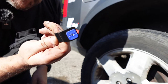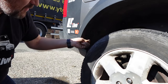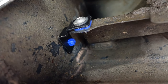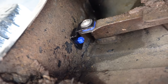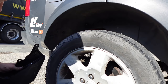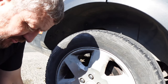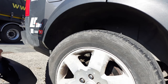You have to put a retainer into the bracket and another one into the square underneath. I'm going to use all the original screws — the one from inside the wheel arch is the best one to fix it into position. The bracket is fixed with an original screw into the speed clip, goes round and faces forward toward the wheel arch trim. That's really the only hard part of the installation. Once that's done you've got three fixing points — the additional one at the bottom, the existing one at the top, and the lower one into the sill. They give you some super long screws with nice washers for good purchase.